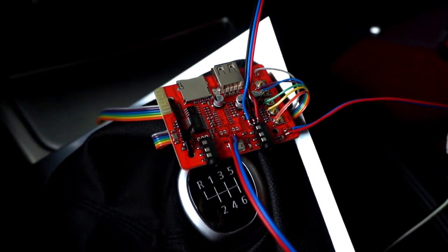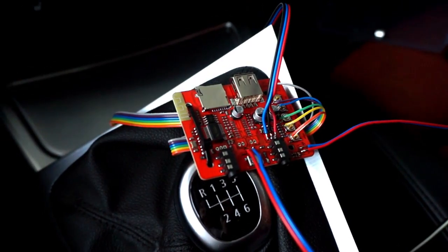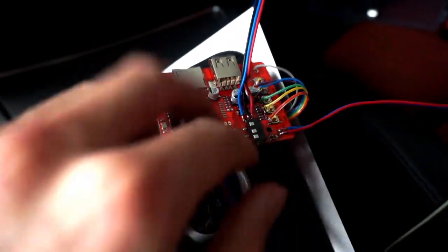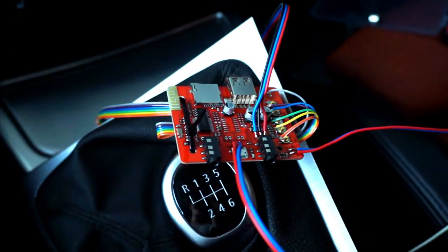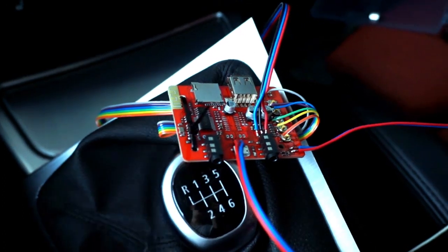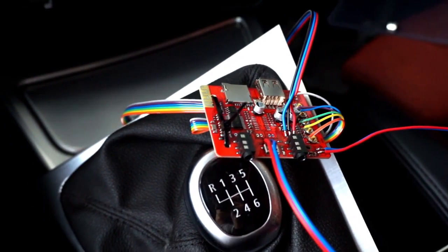The most important device over here is this Bluetooth receiver and I needed to slightly modify it to fit my needs. What I did is solder four sets of wires: one is for power, one is for the audio signal, one carries the microphone signal, and those colored wires are for the button override. I could have used the 3.5mm jack and the micro USB connector, but I wanted a permanent install without the risk of something disconnecting from pulled wires.